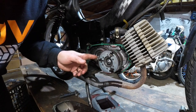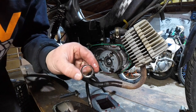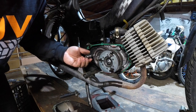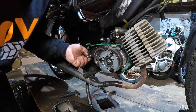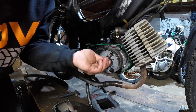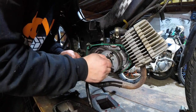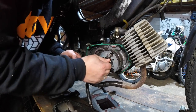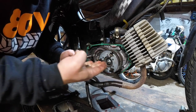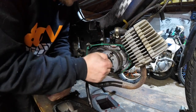I assume this is going to leak everywhere — but actually, there's fluid in there, which is better than no fluid. There's a normal amount of silver in there, and it looks like we managed not to tear the gasket. When you're tearing stuff like this apart, you've got to listen. That's a shim — it goes here, looks like maybe it was too tight, some of it is still on there. That's ruined, so we're going to set that aside. There's usually a shim on the crank, and the crank bearings shouldn't move laterally — they've got some play they shouldn't have.